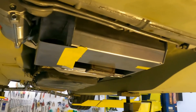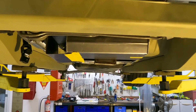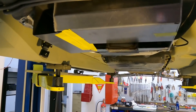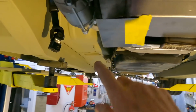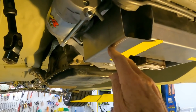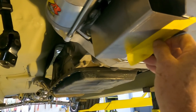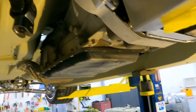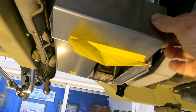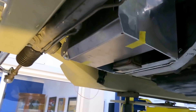Because we've knocked 30 mil off the bottom, the aim is to get the engine sump up to the same height as the transmission. You can see the pickup here hanging out down the bottom, so that'll obviously go back up. We've taken 30 mil off the bottom of the sump and we're just trialling how much of an extra wing we can put on here to get our capacity back up to what we need. By my calculations, that'll get us back up to the same capacity that we had before.